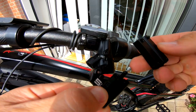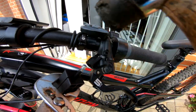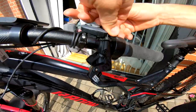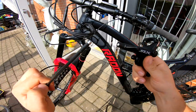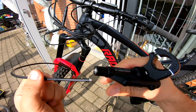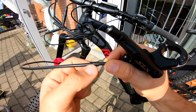Simply tap it in with a rubber hammer or something similar. Step 5: remove the plastic handle. I suggest not putting the brake handle on the handlebar yet, before adding the end cap — because when turning the screw or end cap in, it might twist the cable a little bit.